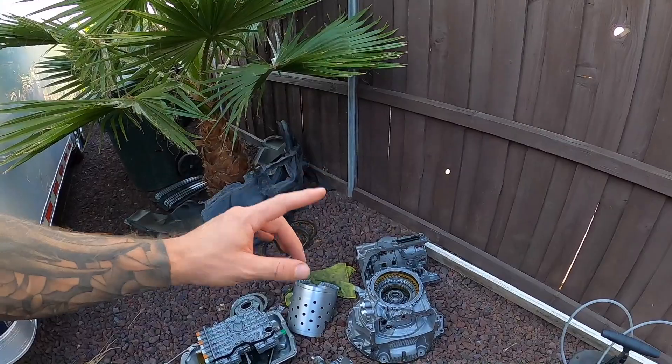Before I walk away from that, a lot of guys said maybe it was a driveshaft vibration. We got the driveshaft inspected even after this failure and it still balanced out true. The original driveshaft for the Hellcats is a two-piece design — they have a carrier bearing. That's kind of what I realized yesterday. The driveshaft we're using now is a one-piece instead of a two-piece.